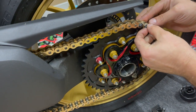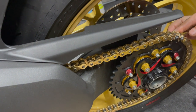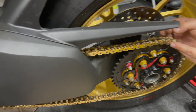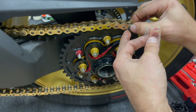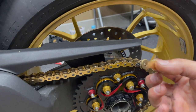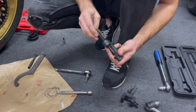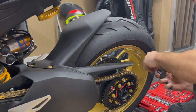So what we just did — there are these four O-rings, but they're actually called X-rings. They're X-shaped, not regular O-rings. These chains come with a grease packet, a little tiny grease packet. You put a ton of grease on there inside and outside. You want grease on this side, and then once more put grease on that. Then you put the cover or the link over it and crimp it down. And that's it.